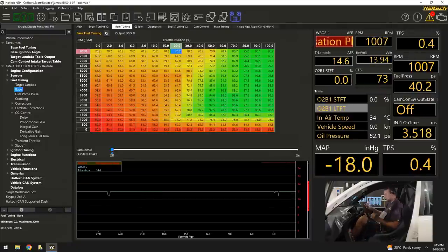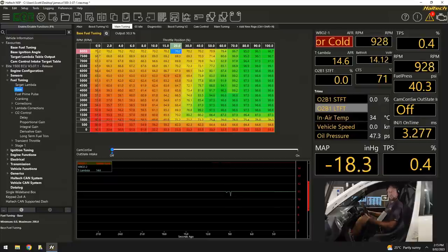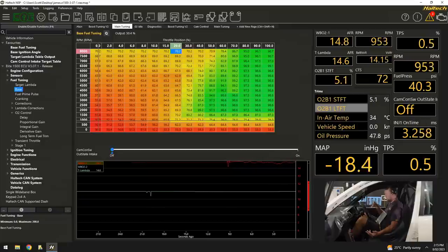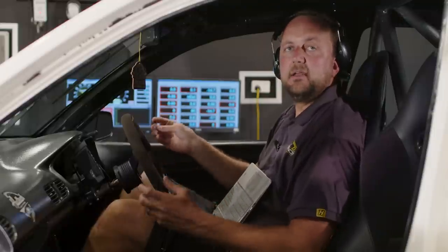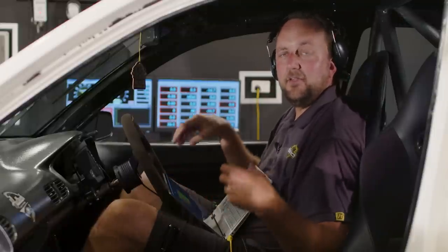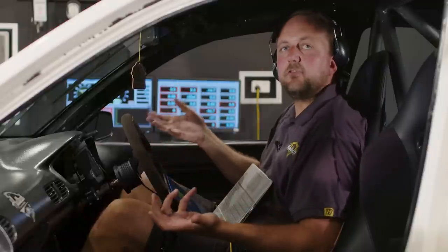Probably an interesting point there. You could see what I've just done. I've just thrown the fuel map together. I know the engine size. We've got a manifold pressure reference. I know the injector size. I've roughed in the injector data for the dead times because truthfully, I don't know what they are. And look what's just happened. The engine started and is running and we're about 4 or 5% lean at that spot right there. So that's something to show you that using the VE model, if you enter in the rough data and if you know that 50% at idle, 100% flat out, this is how the engine should start and run.